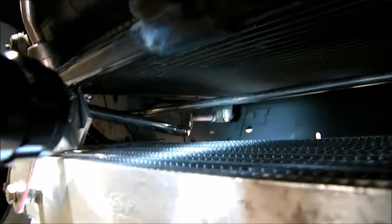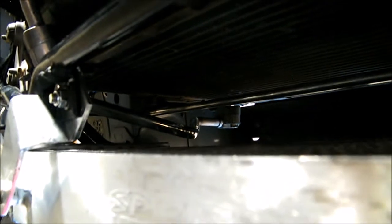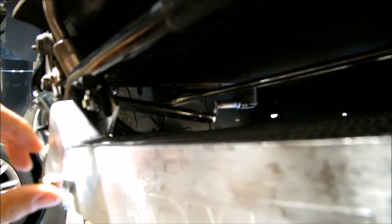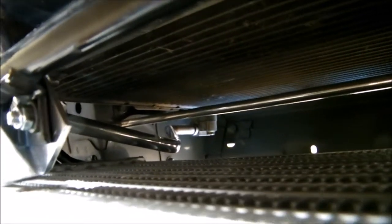In the back here, you've got to make clearance for the air conditioner line right there. I'll try to get in at different angles so you can see the clearance. I made sure there's enough clearance - I can stick my finger in there between the intercooler and the line, so it isn't really going to hit even with vibration going down a bumpy road. There's plenty enough clearance that it's not going to rub a hole through any of the lines.